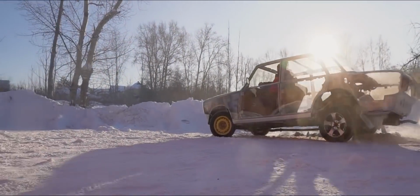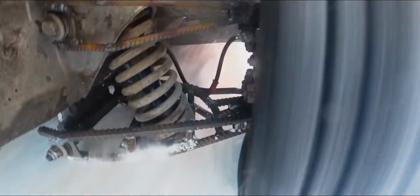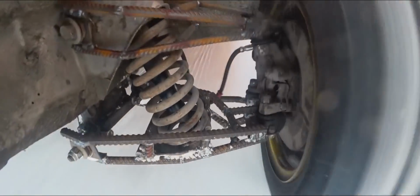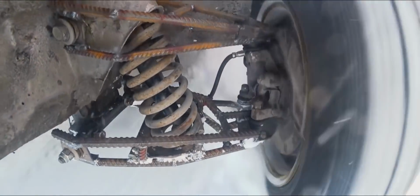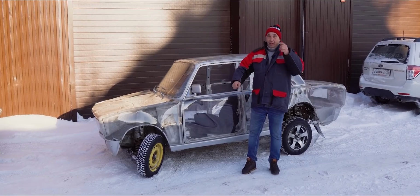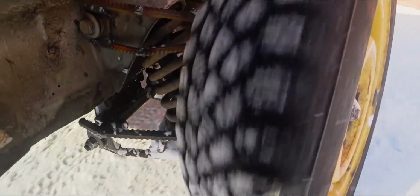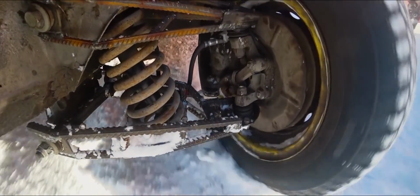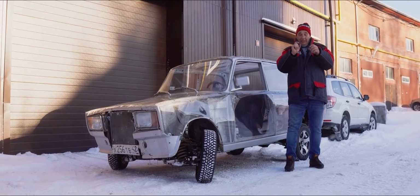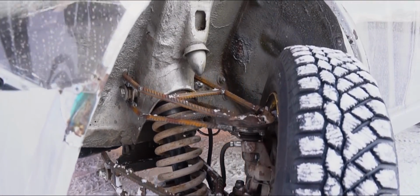Now, after going for a drive and putting these arms through their paces, you saw the roads I was driving over. The terrain next to our facility is so rough that it'd easily take out a suspension arm if it were too weak. You've got ruts and jumps, potholes that are almost knee-deep, snow, a groove, everything you'd want to truly test suspension components. And ours are holding up nicely. Nothing broke. We also did a good job with the angles. It's quite often that we cobble something together and end up with something that is really good. And just look at how much steering angle we got. Now that tiny recess in the arm which allows the tie rod end more movement, that is just such a good solution. I really like what we've put together.